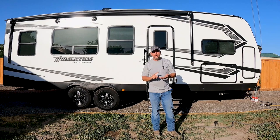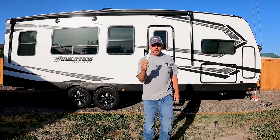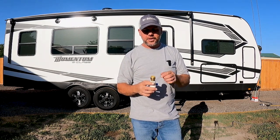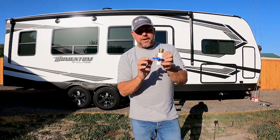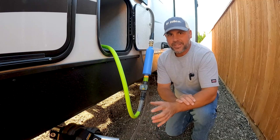Friday night, Saturday, Sunday morning we actually ran out of water in the fresh water tank. So here's what we're going to do — we're going to fix that with a ball valve and a SharkBite. Our overflow tubes are coming out of the bottom of the trailer in three-quarter PEX pipe, so I'm going to use a SharkBite that slides right onto that and a half-inch PVC ball valve. After our tanks get full we can turn off the ball valve and keep the water in the tank.